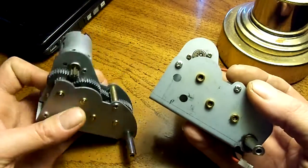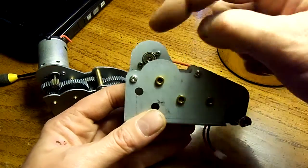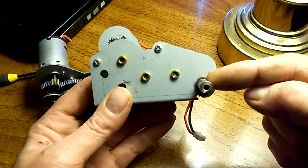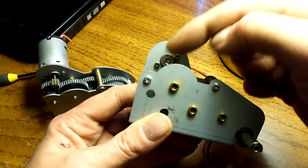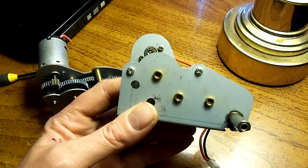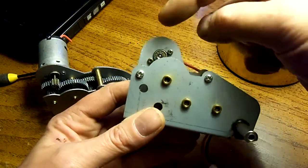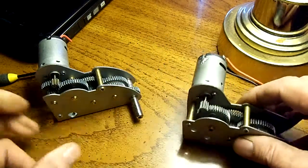Calling it three-to-one and four-to-one is extremely inaccurate. Your final drive ratio would be figured by how many times does this pinion have to turn to make this axle turn one revolution. If it has to turn a hundred times, then it's a hundred-to-one ratio. I always get that mixed up, but you know what I'm talking about - turn a hundred times, turn one time, hundred-to-one ratio. It's pretty simple really.